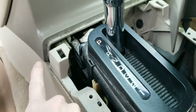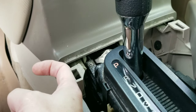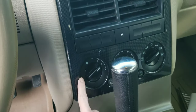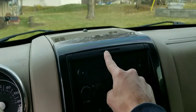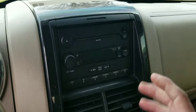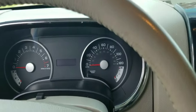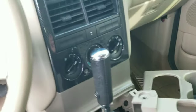This piece sticks out farther, so you need to pull out to the outside of the vehicle and then toward the back of the vehicle. There will be several clips right here. One thing I want to point out: this is the airbag light — very hard to see, but do not unplug this while the key is on. If you do, you will have to take it back to the dealership to get this light to go off, and you will have an airbag light showing. So I'm going to go ahead and pull some of this out and start showing you more about taking it apart.